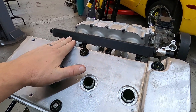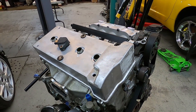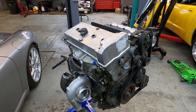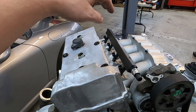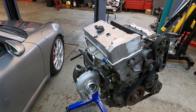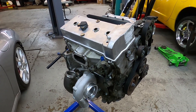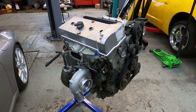The reason for all this is so that we can get the clearance we need in the engine bay because it's very close in this spot here. The valve cover is basically finalized. It needs a spot to fill it with oil, bungs for a catch can, and a little bit of finishing up of the holes to make them line up nicely, because this is just the rough Sandcast version. But it is basically ready to go and we can finalize this and move forward with the engine swap.